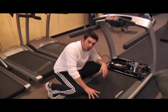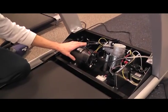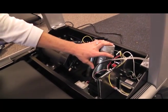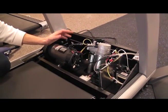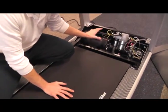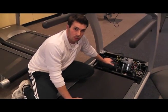As well as using our shop vac, inside here we're going to be vacuuming out around our motor and all these crevices, as well as the incline motor and then around your lower board. Removing as much debris and dirt as possible — removing all these things is going to give us a lot more life out of this treadmill, as well as cause a lot less service issues in the future.